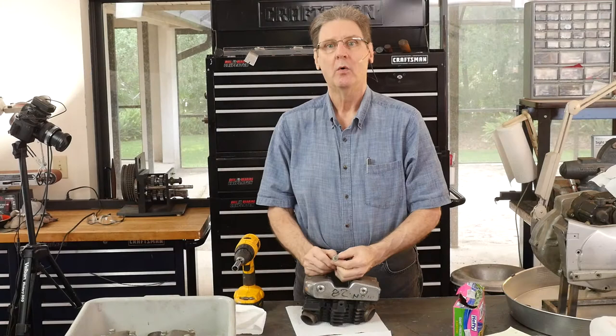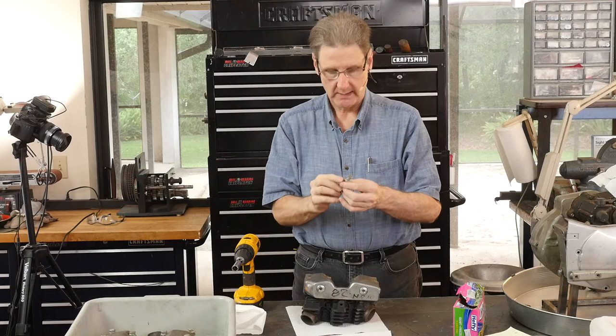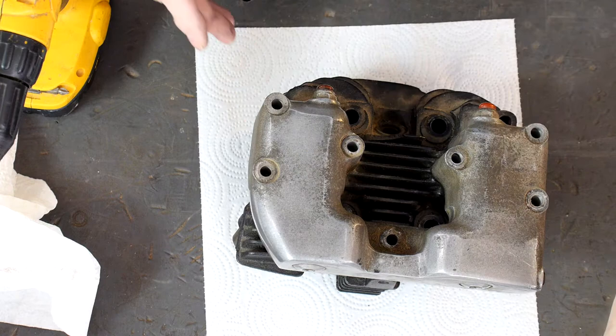I am a big believer in lock washers — old-fashioned lock washers. Working at a military contractor, I learned they wear out. You're only supposed to use them once. If you crush them and made a mistake, throw them away and put a new lock washer on. I also have grade eight — these look like AN size, not the big SAE size you get at Home Depot. It won't take the standard kind of washers from the hardware store.